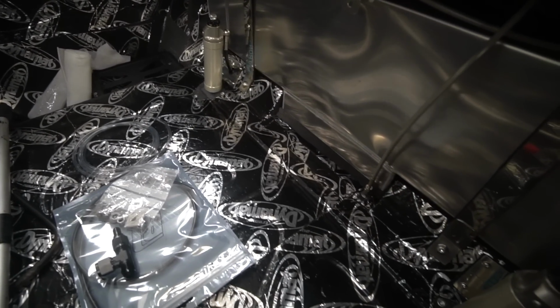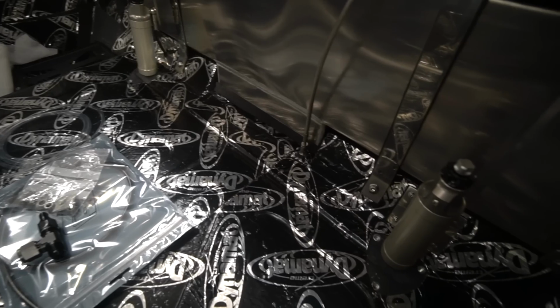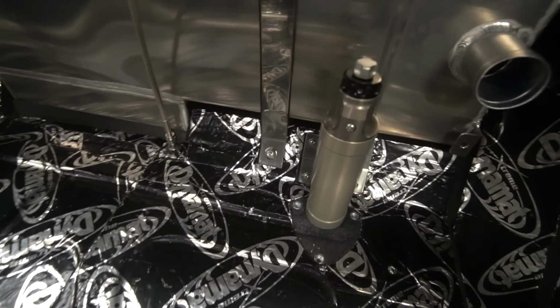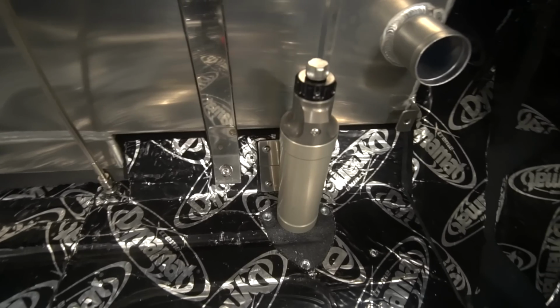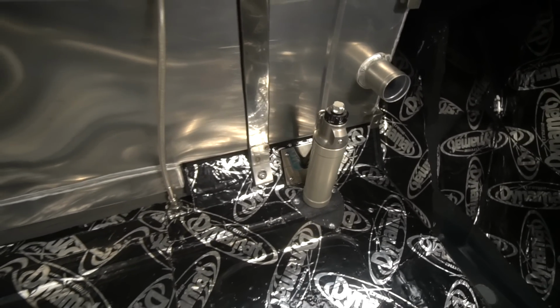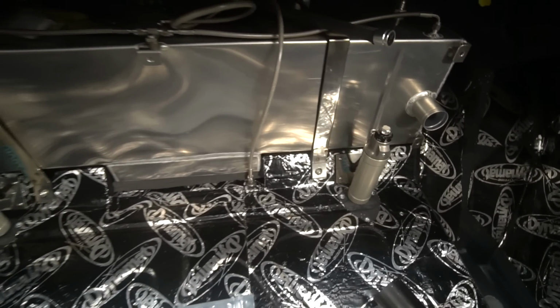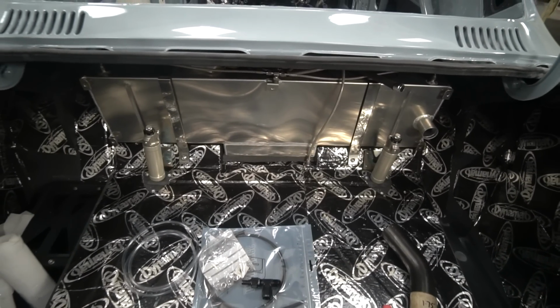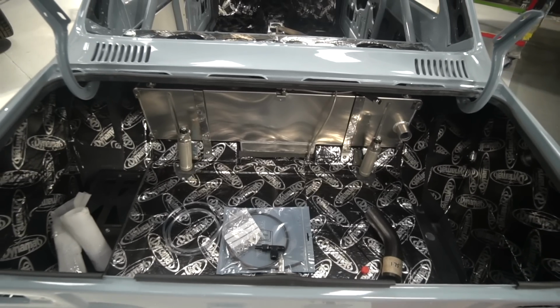So what we did was, at metalwork phase, we planned out this technique where we'd have a big hole that could pass through, and then some bolt holes, and we'd do some closing plates that went in after. So that's what Anthony's done. He's basically designed a stainless steel plate that's got a round hole in it, but it's split completely in half, so you can then put the two sides of the plate together with a grommet around the hose. He's then made some little neoprene gaskets to seal from water or whatever coming in, and then they bolt in.